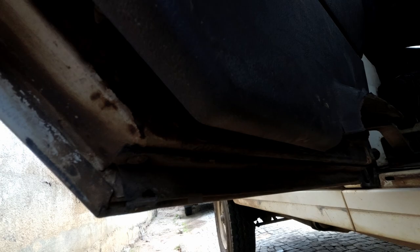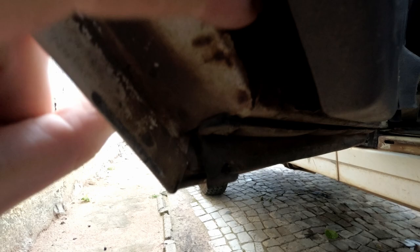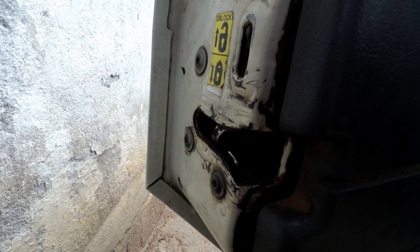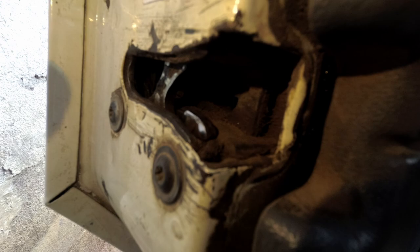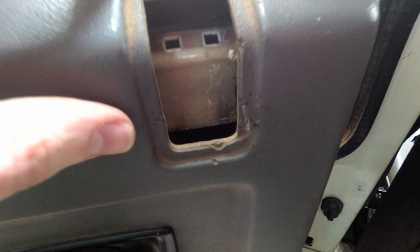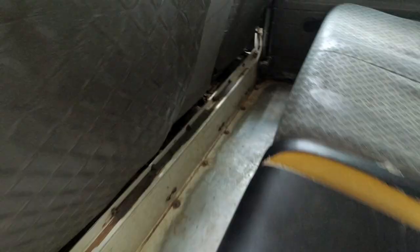Let's feel the door action. Door cards are naturally coming off. Seal is still on there, tiny bit of corrosion but not a whole lot. Full of dust and dirt. Still got the original child lock sticker on it. You get this kind of wear here - this is basically where the door rubs, it wears off the paintwork. You can see the door seal is worn down to metal because of the vibration. I've seen this in the rental Defender in South Africa as well. All the door locks are missing - on all the vehicles I've seen here and over there, they're just completely missing.